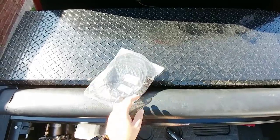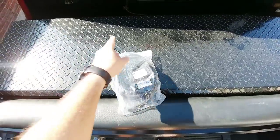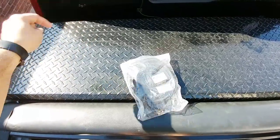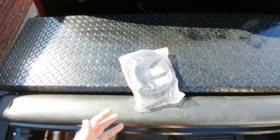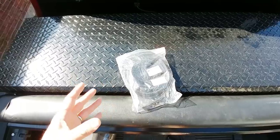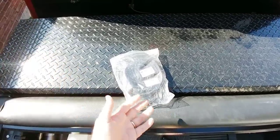What I'm going to be doing today is installing this piece of sealant across the back of the toolbox. Basically where the toolbox butts up against the back of the bed, there's a little gap — if water runs down, it can get into the truck. I'm not under any illusion that this is going to be water tight, but it's definitely going to be better and it's going to limit the amount of water that can make it into the bed of the truck whenever it's raining hard.